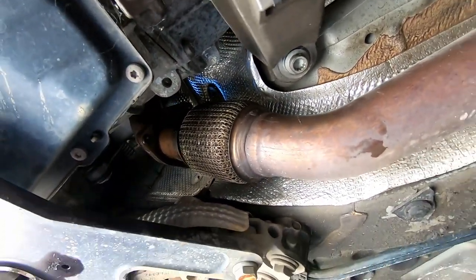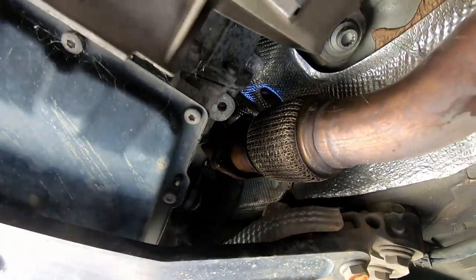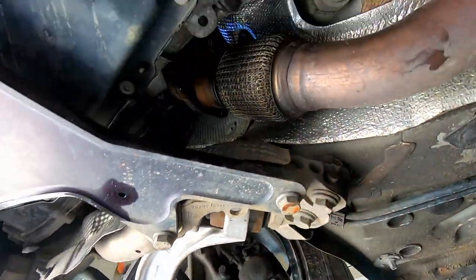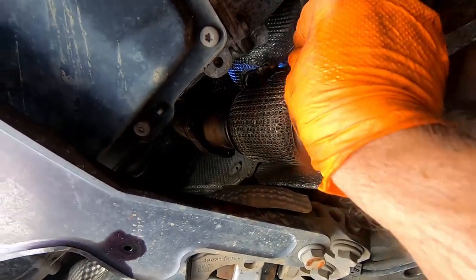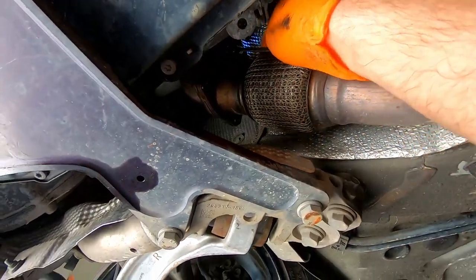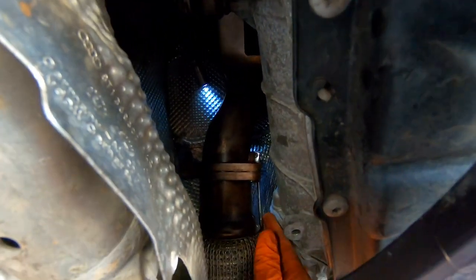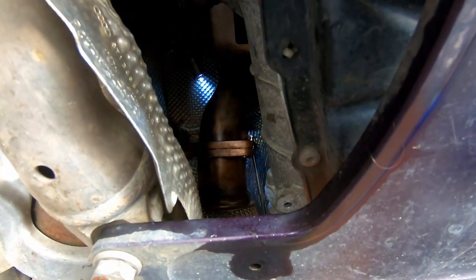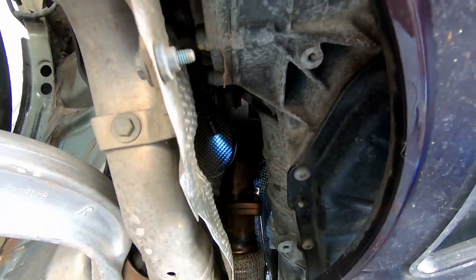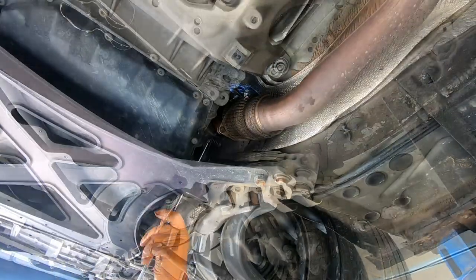Okay, there is no way to get it from the top to the passenger side upper nut, and I'm slowly starting to remember, like Schwarzenegger in Total Recall, what I did last time to get there. I used this wrench with a swivel head, and I was able to put it on the nut on the top, and then I used a long extension and hammered on the pivot point of this wrench. Let's see if this trick is gonna work this time again or not.